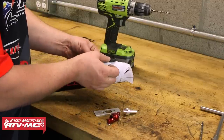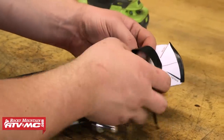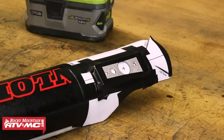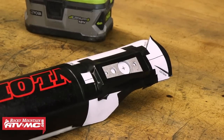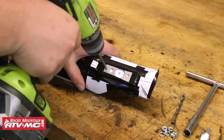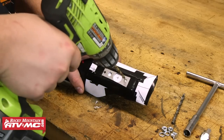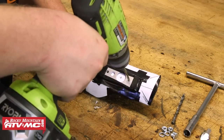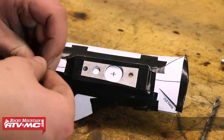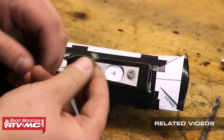After we've got that taped into place, we're going to take the supplied aluminum drill guide and line that up on the template, and go ahead and tape that down as well. You'll want to make sure you tape this on all four sides of it. After that, we're going to take a 3/16-inch drill bit and drill the two 3/16 holes through the drill guide and through the fork guard. Then we're going to temporarily install the two Phillips head trigger screws, and those are going to help hold that drill guide in place while we drill the other two holes.